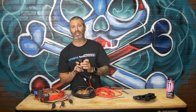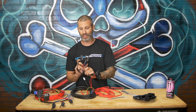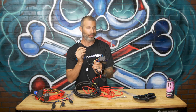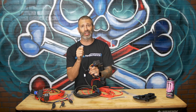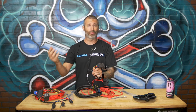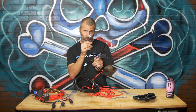This is the most common thing I get asked about — what do I do with the wiring, what do I do with the relays? Simple. There are two things you've got to worry about. Black wires with lugs on them — it's pretty self-explanatory. These are ground for the relays. You're going to ground them to the chassis at a proper grounding point. On the 99-04 Mustangs, where the fuel pump driver module is — ground it there. On the 05 and up cars, same thing — factory chassis ground with the ring terminals.